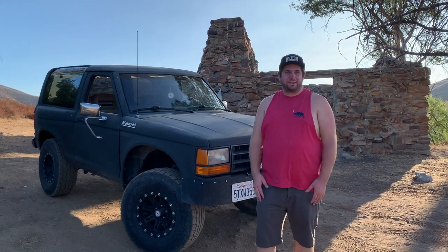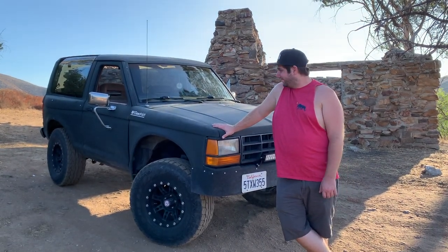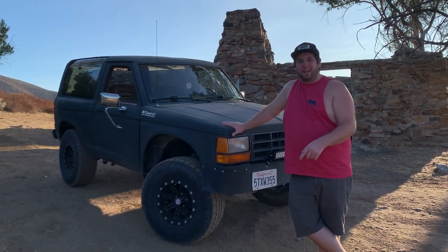It seems to be running pretty good. If we're climbing for a long period of time and giving it gas up a hill, it does start to get onto the higher side of normal on the gauge. Checked it with a temperature gun and it's actually running about 210 degrees, which is pretty much okay, because it cools right back down as soon as you give it a rest or start going downhill. I think that's going to be all right for now — maybe in the future I'll upgrade to one of those crazy high-performance fans. We got a pretty big test coming up, so stay tuned for the next episode. Just goes to show: keep at it and you'll get it figured out. Also, make sure you test your car before you do anything too crazy with it. Remember to like and subscribe — we'll see you next time. Attack your garage.